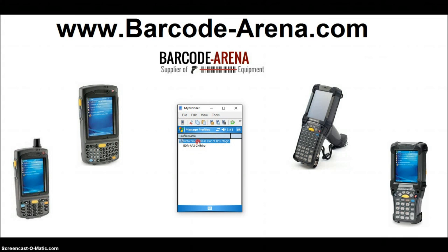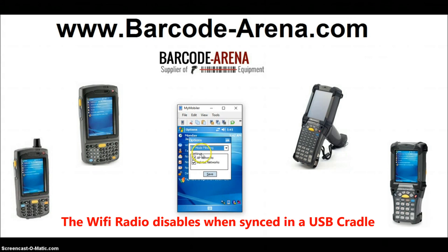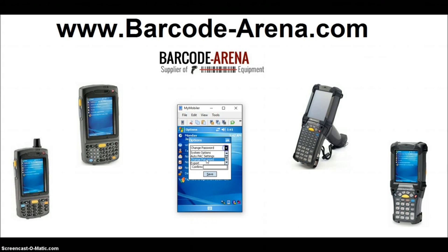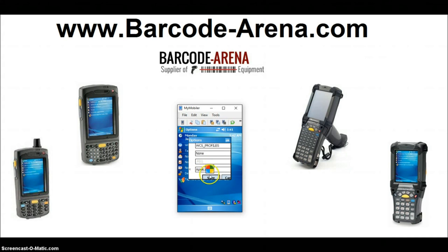Highlight the dummy default profile, right-click it, and disable it so you're not constantly trying to reconnect to that network. Close that out — you can see we're now connected. Click your wireless radio one more time, click Options, drop down to the bottom, and export your profile — click 'Export All Profiles' so you never have to set this up again. And that's a success — that is how you set up Windows Mobile 5.0 on your Wi-Fi network. Thanks guys, bye!